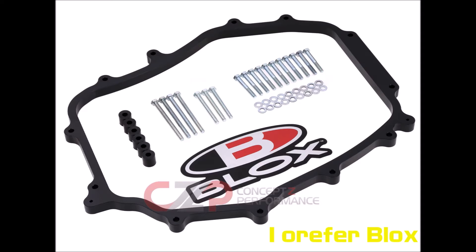The honorable mention — number six on the top 10 — is a plenum spacer. It really helps the non-rev-up DE engines the most; for the rev-up DEs it's debatable. They're cheap and super easy to install. I had an A-Block plenum spacer for a long time — about $100, made from dense plastic — and it isolated heat between the lower and upper plenum while also acting as a spacer, killing two birds with one stone. There are lots of options and you can't really go wrong with any of them.